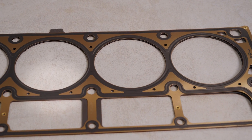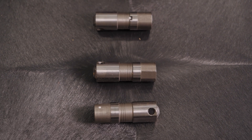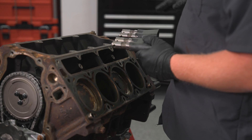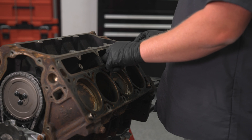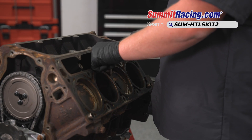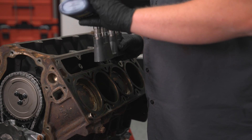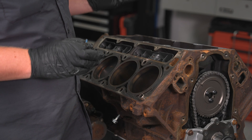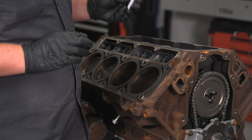So I have some of our Summit drop-in Morrell lifters, which are a really good high quality LS lifter — I'm super excited about those. I got our lifters all lubed up and got them installed in the lifter trays. This is our Summit lifter tray and Morrell lifter combo. Two down, two more to go. We have all four of our lifter trays and all our lifters installed, and now it's time to throw the lifter tray retaining bolts in and get those torqued down.